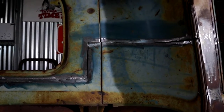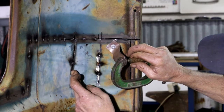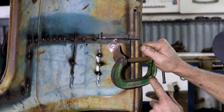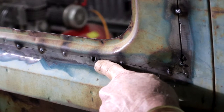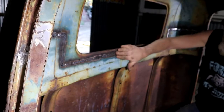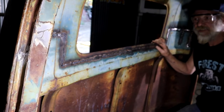So I've still got to do something about this joint on the inner skin right here. There's quite a bit of surgery going on in this corner on the inner skin — I've done quite a few pie cuts already. You do whatever it takes: got a piece of scrap screwed on to this part here, then a clamp so that I can lever it to line my edges up. Quite a mission but I'm getting there. That's what happens if you forget to crank down the amps — when you start to tack this thin stuff together. It's a boring business welding all of this together — little one-inch spots at a time. But somebody's got to do it and the only someone around here is me.